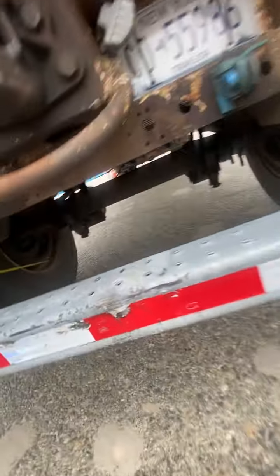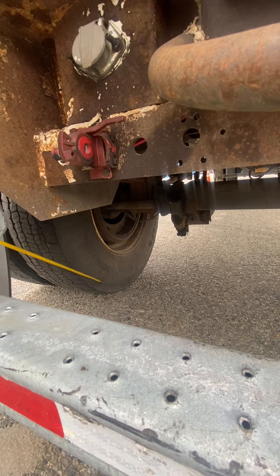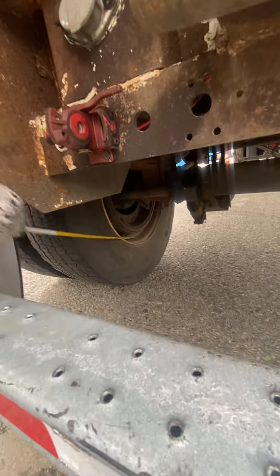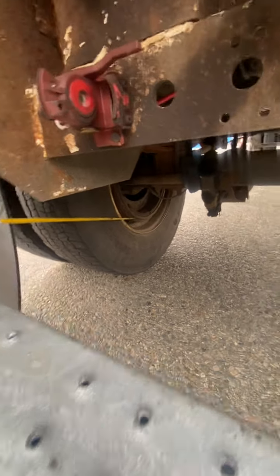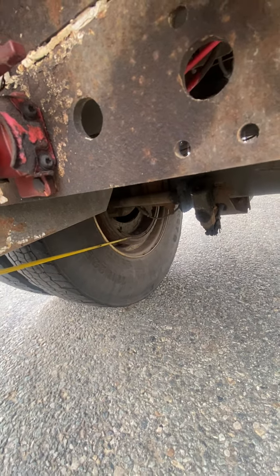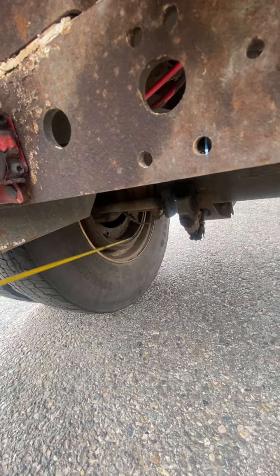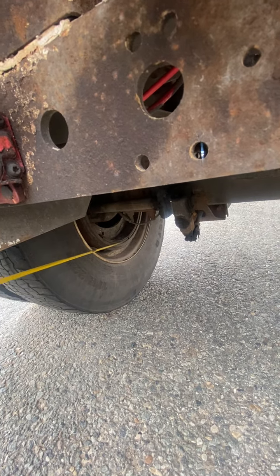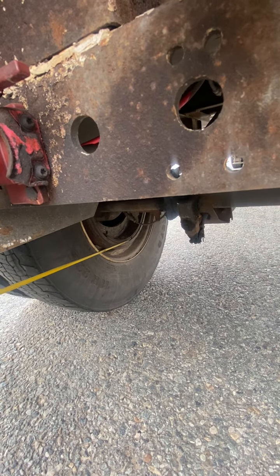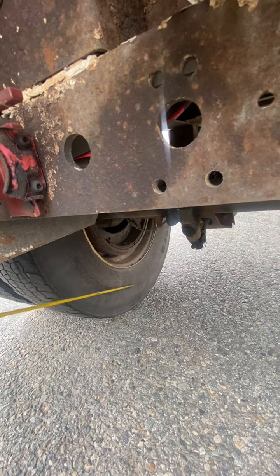Standing over here to point at the inside of the tires — the rear tire has no cuts, no damages, no bubbles. Inside rims are secure, not cracked, not broken, no illegal weldings. The drum is secure, not cracked, not broken, no garbage or debris on top, and no oil between the drum and brake pads. Brake shoes cannot be less than one quarter inch of thickness, and they're not damaged.